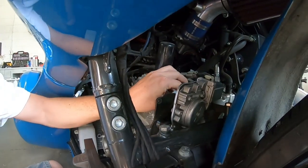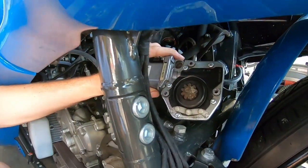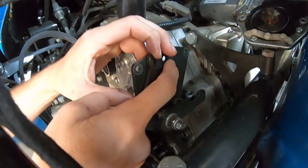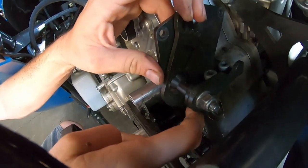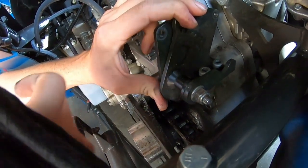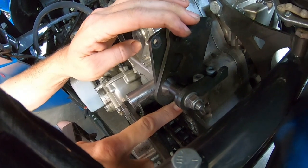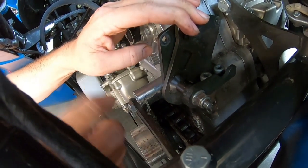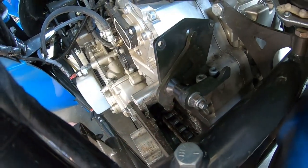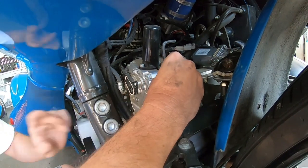How this operates: here's your window motor — it runs on this gear. Once you hit reverse, it turns this gear, so that gear rides on this bracket. When the pin is out, you only have reverse. When you turn on the bike, it's turning that gear, pushing this bracket down and pushing that pin in to activate your forward gears. When you hit reverse, it reverses the window motor, pulling this bracket out so the pin can come out — that's what activates reverse. The only way it fails is if it doesn't activate the reverse; it will go forward all day.